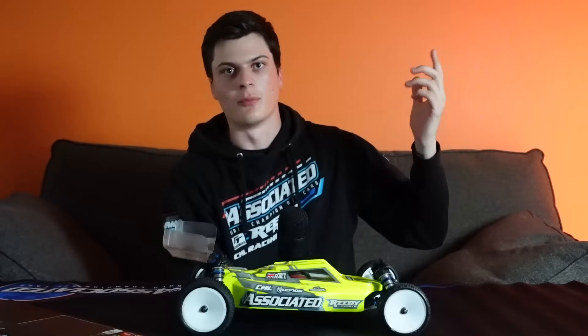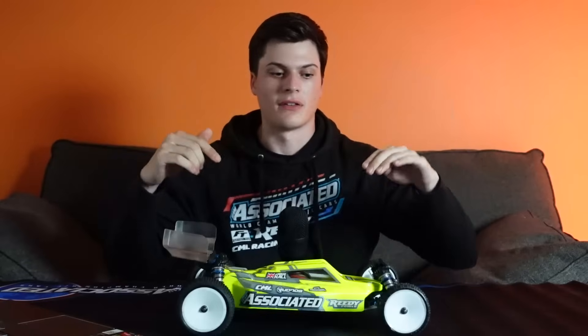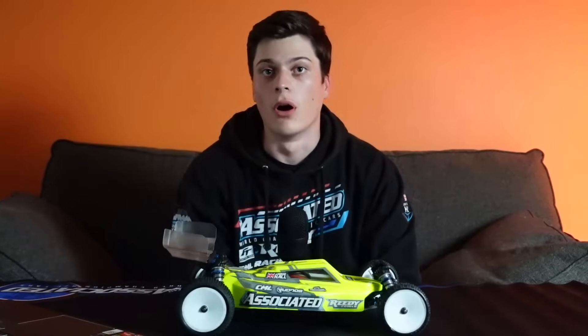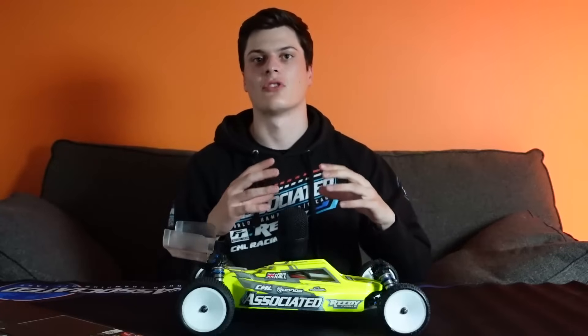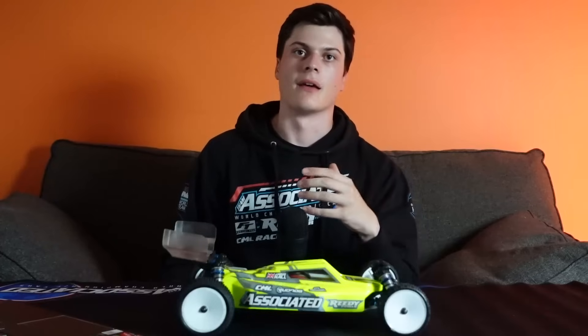If you really want to learn in depth about roll centers, I have done videos about it before - linked above and in the description. But what we need to know for this video is that when we lift the arms at the outside, the link is going to be angled more downwards in the middle and more upwards towards the outside, and what that does is lower the roll center. A lower roll center on its own makes the front end of your car slightly less responsive - more of the force goes through the tires and into suspension movement rather than directly back into the wishbones and links. It allows the suspension to move more, so when you turn in your car is going to dive down a little bit more, not respond as quickly, but maybe turn slightly more in the mid-corner and exit on its own.